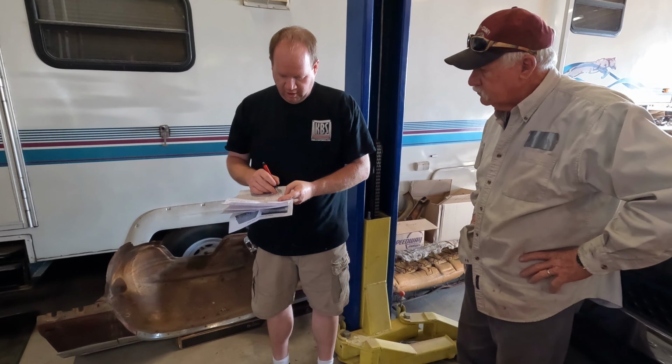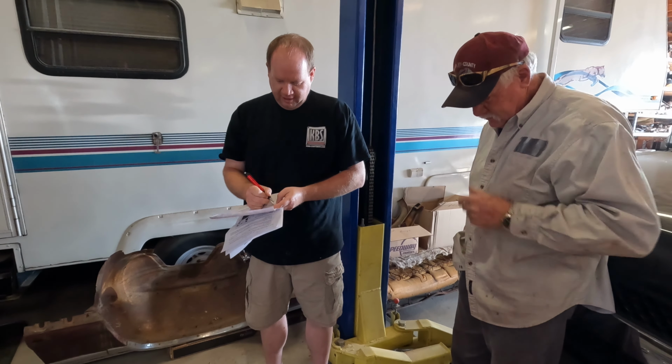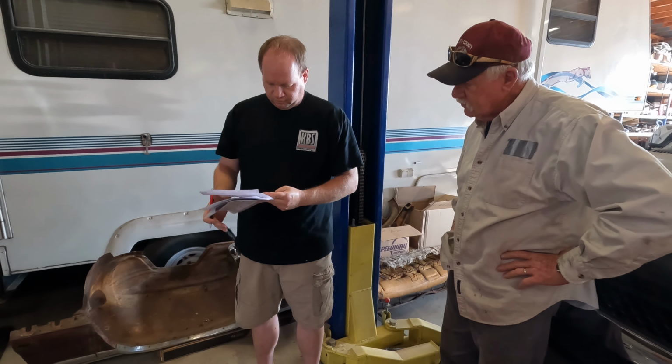Because that's adding an eighth of an inch and it's going to make my calculating easier, we're going to do half of 6.5, which is 3.25. So, 3.25 from the bottom of this to the center of this, and then we'll put our arm on and that'll adjust our fuel level. And so we'll get started here with this pump.